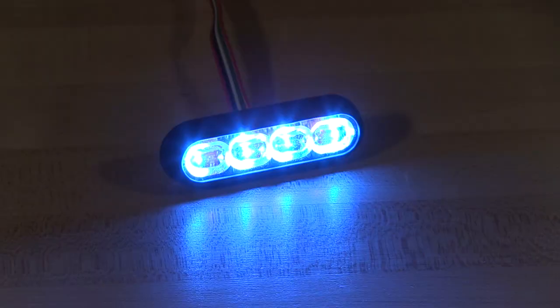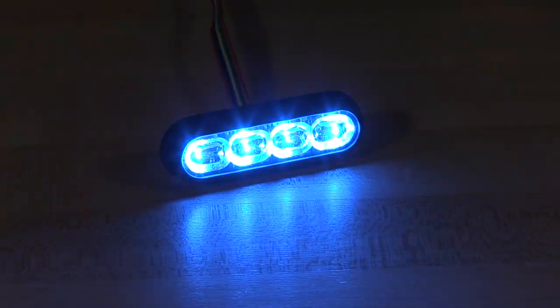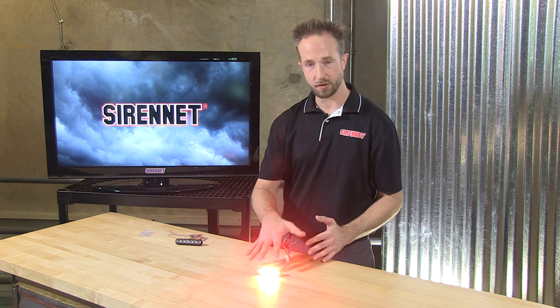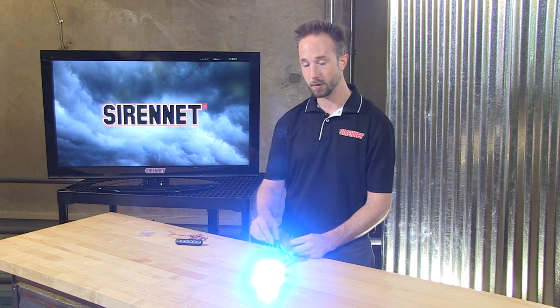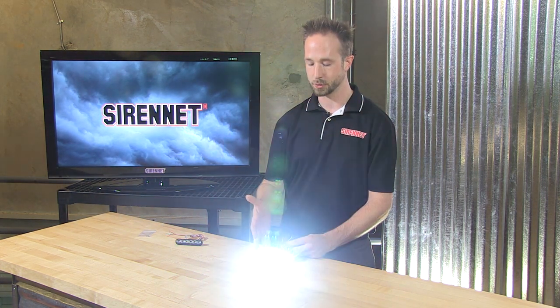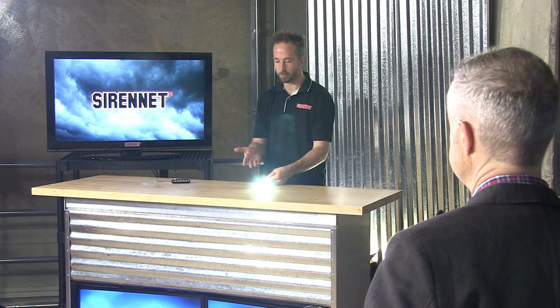User-selectable flash patterns are available: in the single color format, a total of 12 for you to pick from; in the dual color and tri-color, a total of 14. Something for everybody, and nice and simple. Flashing away in a basic flash pattern mode you could select from — perfect for the front of the vehicle. If you want to make flash pattern changes, easy enough to do with the five-wire pigtail harness. Tie this into your siren and lighting controller and vehicle electrical system. The white wire, when momentarily applied to a ground source, will change the flash pattern — just tap the white trigger wire to the ground source until you find the appropriate one.